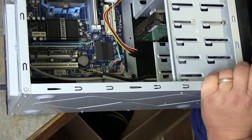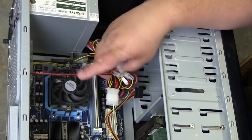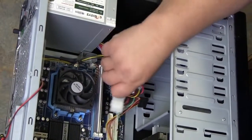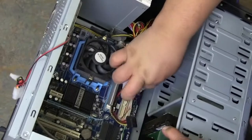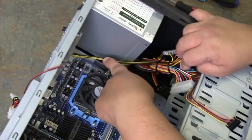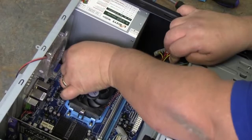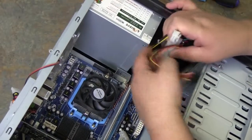Set these off to the side. We're going to start disconnecting power to everything. This power cord connects to a case fan — simply unplug it. This power connector connects all the power to the system board — squeeze and pull directly out; it's got a little clip that clips onto the side. Another case fan — unplug. And you have a four-prong power connector down here that supplies more power to the board; it also has a squeeze pin and pulls right out. Now your power supply is completely disconnected from your system board.